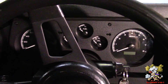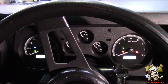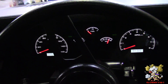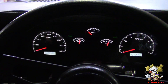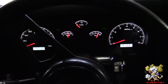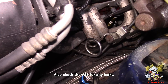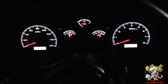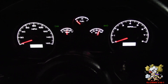We had the car running a little bit — let me show you what it looks like. When you shut the light off — voila! It's sheer beauty. Water temperature is good, oil pressure is good. Let's start it up and check real quick for any leaks. No leaks at the water sender, and no leaks down there where we put the oil pressure switch and the sender. Now we have to set the speedometer, the odometer, the fuel sender, and the tach.